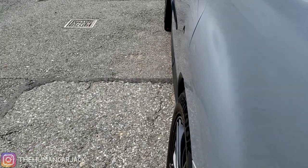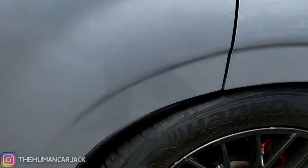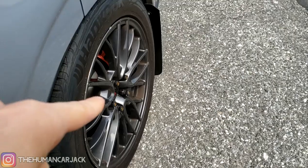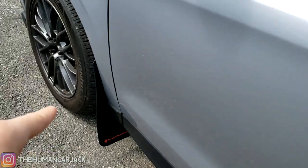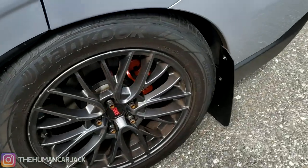So it's sticking out about that much — you can see it in the front too. As far as camber settings: in the back we have negative 4 degrees, and in the front we have negative 3 degrees of camber, so a little bit different on both sides.